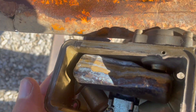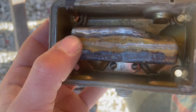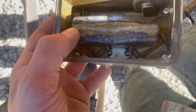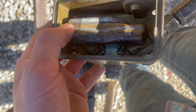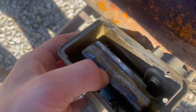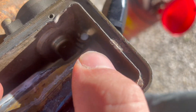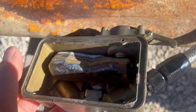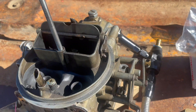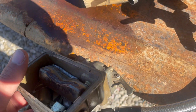Setting float level is a question that usually involves getting it running and then taking that screw out to see the fuel level. But I found that if you just want somewhere to start, if you get your float level set to about right there where it's just level — the top of the float level with the top of the carburetor — that's a pretty darn good place to start. You can see on this side where the fuel usually sits, it's about to the bottom of that plug. So somewhere around there to start, and then you can check it after it's running. I've never actually done that before; I just set it like this and it seems to work just fine.